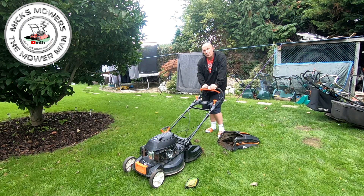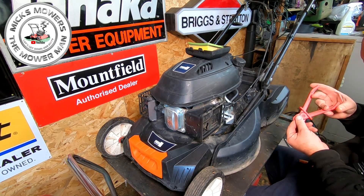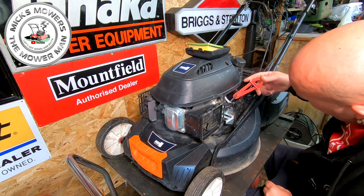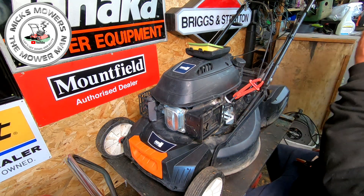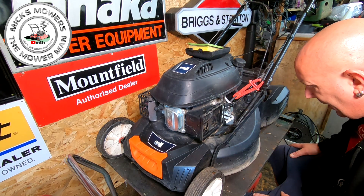If I can get the spare parts of this and they're readily available and it's not too much damage done to it, then I don't see why we can't get this running for Paul. Let's give it our best shot because it is from his mate who gave it to him who's not very well at all. Right, so here we are — got it up on the bench. It's quite a heavy old machine, to be fair. I'm going to stop the fuel off. If I can get it to drive, then we do the service on it — he wants a bit of a service too, so it'll be a new air filter, spark plug, and whatever.